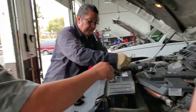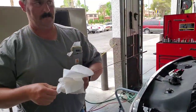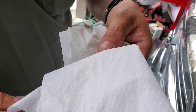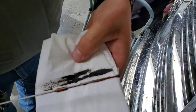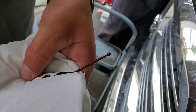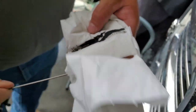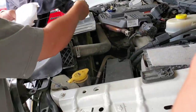Let's take a look at this oil. We're going to give you a little before and after so you see what it looks like before. How many miles are on this oil, Matt? About 3,000 miles. So it's a brand new oil change and that's our color — we're pretty dark. It has that nice painty look, like black paint, and that's common with diesel. You can see that dipstick has a nice dark color to it. We're going to start this up in a minute and see what the oil looks like from the bypass return.